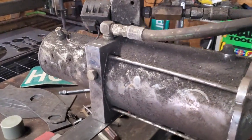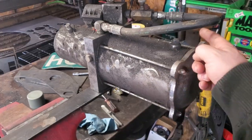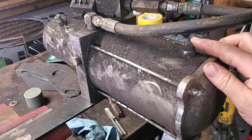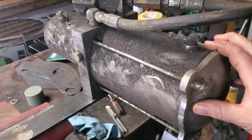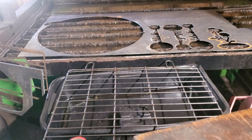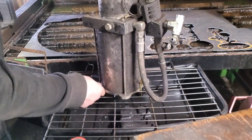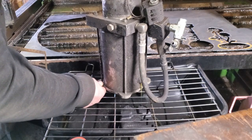She is a beauty, isn't she? Yeah, I wasn't lying about it being rough. This has been sitting on my shelf, been kicked around, under my table for a while, so I just got some grinding dust on it. Pretty much empty the fluid out first. I always say start there because a lot of times I see people pulling tanks off with the tank plug still in there — that actually creates a vacuum and you're kind of fighting yourself at that point. So I definitely want to take that off. If possible, drain it, because you're gonna make a mess. I have put them vertically before and pulled the tanks off with the plug on — it is possible, just a real pain in the butt. The oil actually looks really good.